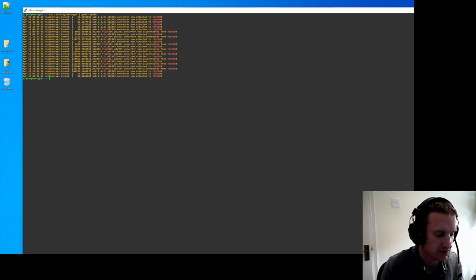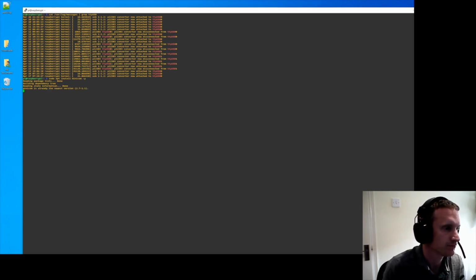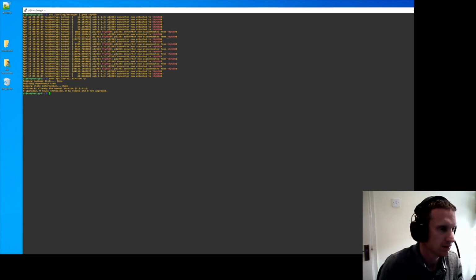So you're going to need to install minicom. So that's sudo apt install minicom, and put the -y on the end to say yes. Now it's going to say that I've already got it installed. It's already the newest version for me. So once you've done that, then you can connect to minicom.